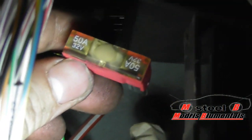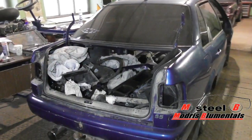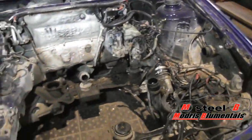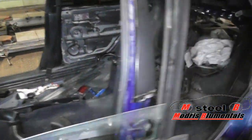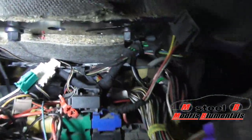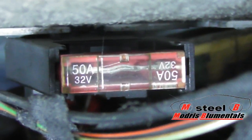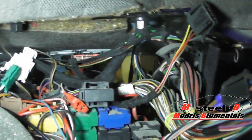There is the glow plug fuse and we can see it's already burned out. Two big wires with a big diameter for high current are connected to it. We have to get this fuse out. Here we go — it's blown up, definitely completely blown. We're lucky that we have an old Volkswagen Passat for our project with the Golf MK1. So we go in and find a replacement fuse. Everything is already taken out, and as you can see, there is our fuse — just where it was, just behind the wires. This one is good: 50 amps — a very big fuse for our glow plugs. Let's pull that one out and put it in our car.